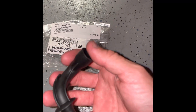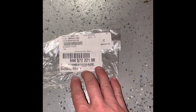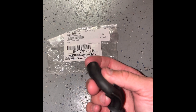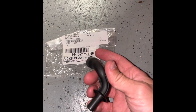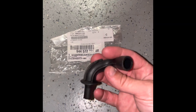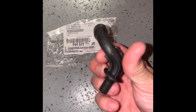This is a new part. It came from 944online.com. Here's your part number for the new part: 944 572 221 00. This hooks into the bottom of the evaporator and drains out above the torque tube in the transmission tunnel — or what would be referred to as a transmission tunnel in most cars.